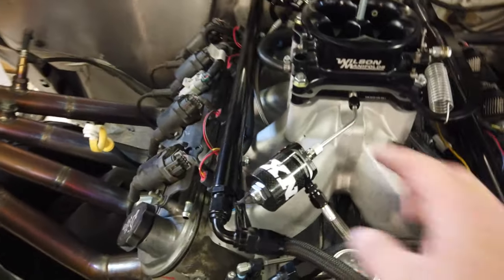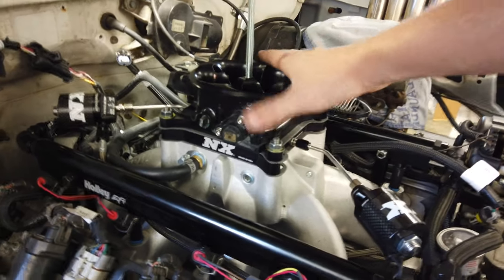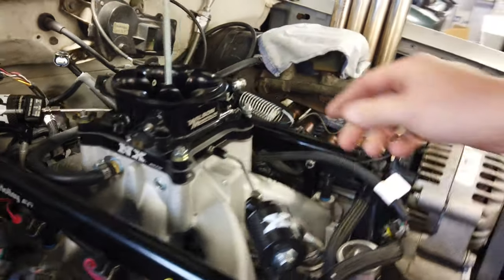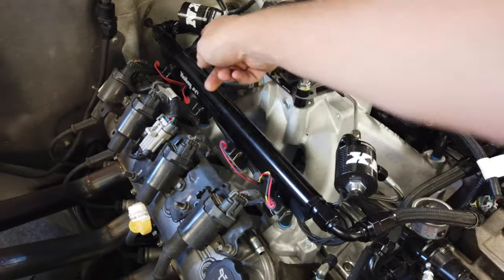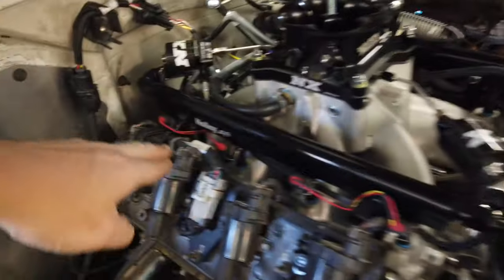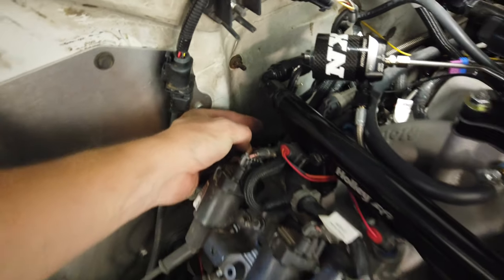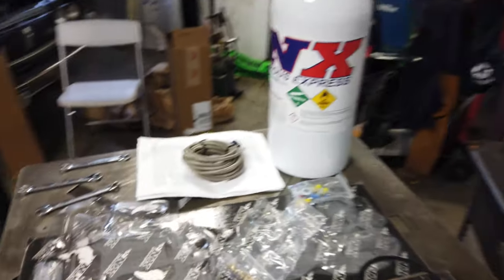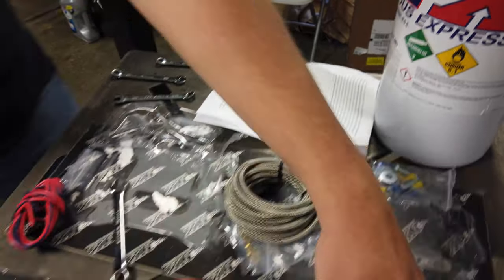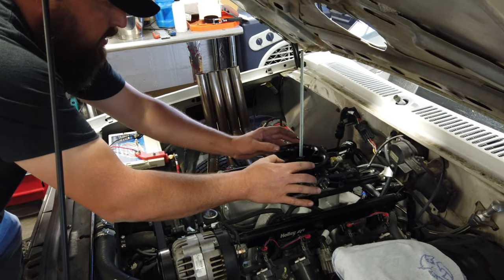Bang! That's looking pretty good. So we got stage one, stage two, or vice versa — this is all mounted up, plates on, good to go. Everything's back on there, we got full throttle actuation, everything looks clean. Ran our lines here and there. Now we have a Y out here and that is what's going to feed the solenoids from the nitrous bottle in the back. So we need to get the nitrous bottle mounted in the back of the truck with these mounts and then run the long line up to it. Don't forget that gasket for the air cleaner.